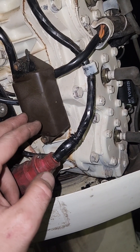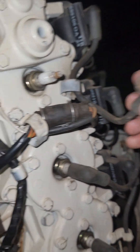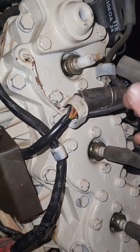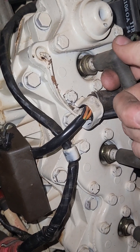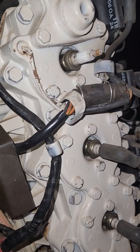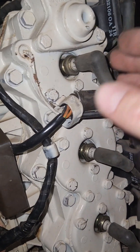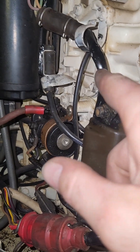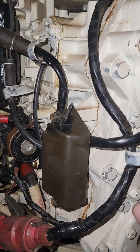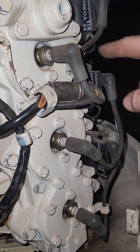The problem I was having was it wouldn't kill the engine. One of my diagnostics was, while it was running, I popped the spark plug cap off of one side to see if it changed. Turn the key to off, and with it sputtering like it does, pull a spark plug cap off and see if it changes the idle. If it does not change the idle, that means the problem is on the other side. This was the particular side having issues with the coil pack. You can also find the black with yellow stripe wire in this harness and try to ground it there as well — it'll be in this side going up to the distributors.